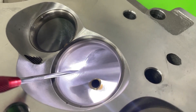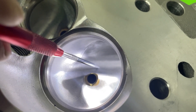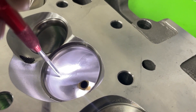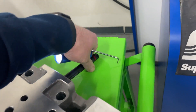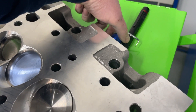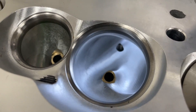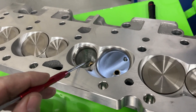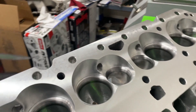Sorry about the camera and the bright light, but you can hardly see any steps at all on the competition port — it's mostly because it's a smoother finish. Let's look at the exhaust. Both of them have the same size valve, 2.10. I'm going to switch lights so you can see better. Now you can see the finer finish more clearly. The exhaust port design is actually the same — this exhaust port looks exactly like the other one; the only difference is the smoother finish.